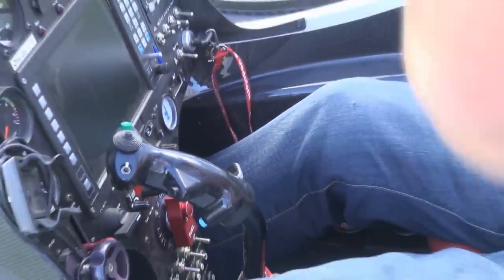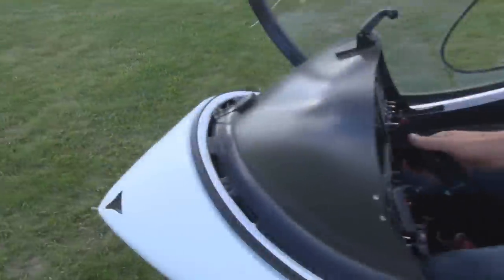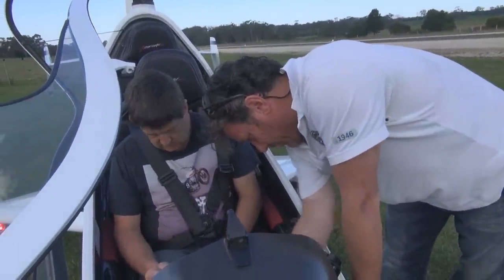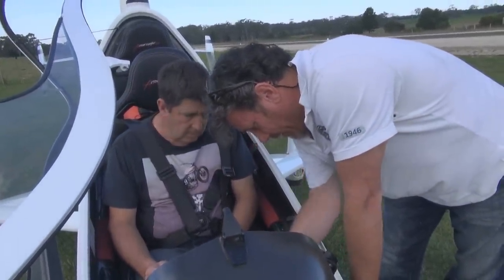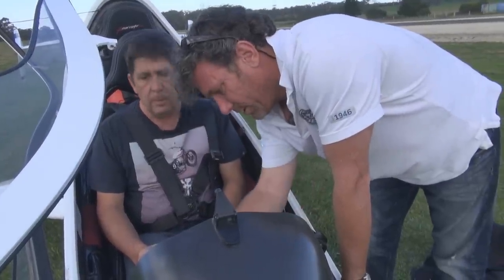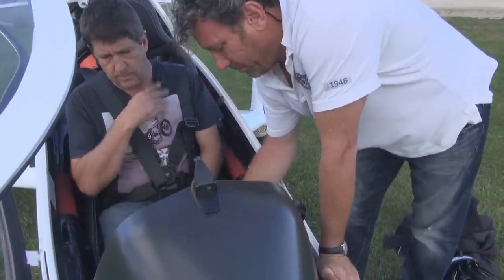Alright, leave those loose so you can lean forward a little. We're pulling from the right tank. No brakes. Duals, fuel pumps, dual magnetos. When you fire it up, just push one magneto down. Have a look at your manifold pressure — it'll go up a little bit. Flick it back up, do the other one. As long as it moves, it'll move.